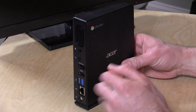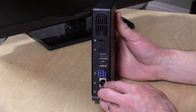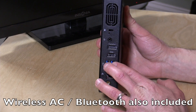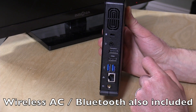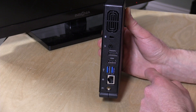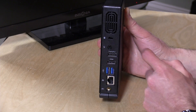There are easier ways to get this same hardware on some bare-bones NUCs or other mini PCs. On the back, you've got a bunch of ports: Gigabit Ethernet, two USB 3.0 ports, HDMI and DisplayPort. It will drive 4K displays, although you'll see some issues with 4K video in a few minutes. There's also a headphone/microphone combo jack, as well as a lock slot to lock it down on a desk. There is a fan on it which will be on all the time, so it does make a little bit of noise.